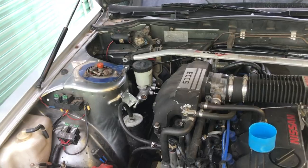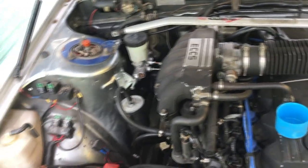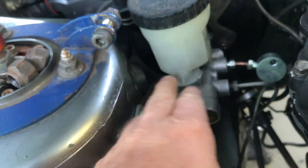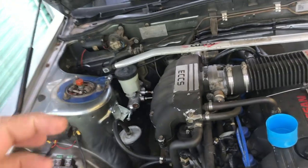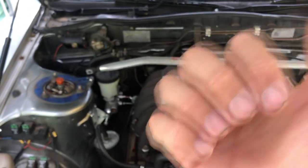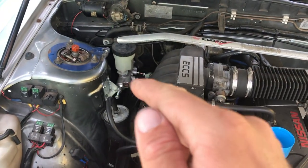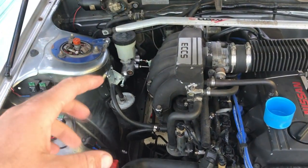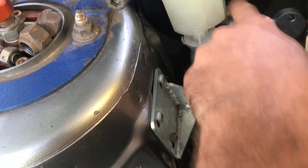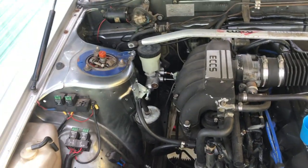Last brake line is the one from the body to the diff. Yesterday afternoon I couldn't get the master to bleed up the front brakes - disconnected them at the master and nothing was coming out. The master was pretty dirty so I had to pull it apart. To disassemble it: there's one screw on one side and four claws that hook in on the other - just pry them off, pop it out, and the piston will come out. You may need compressed air through one of the ports to shoot it out. I cleaned everything, threw it back together and bolted it back on the car.